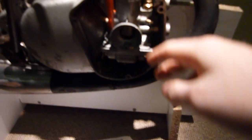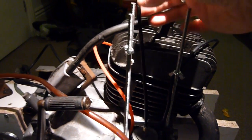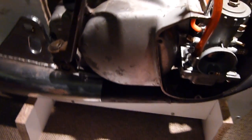It's all kicking over, it's got decent compression, and the carburetor and choke are all working. All the cables are freed off as well. These three threaded rods here — I'm going to put a bit of wood over the top with some holes in and feed these through so I've got a nice thing to operate them from. The clutch cable is meant to go straight to the handlebars, and the throttle cable goes into a two-to-one cable — one goes to the oil, one to the throttle.